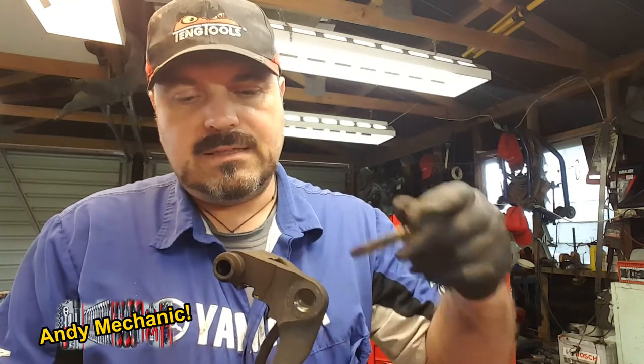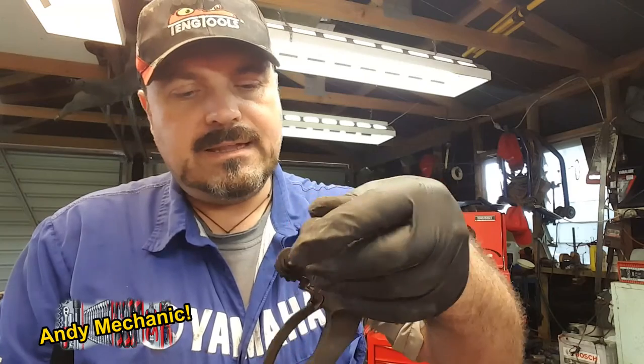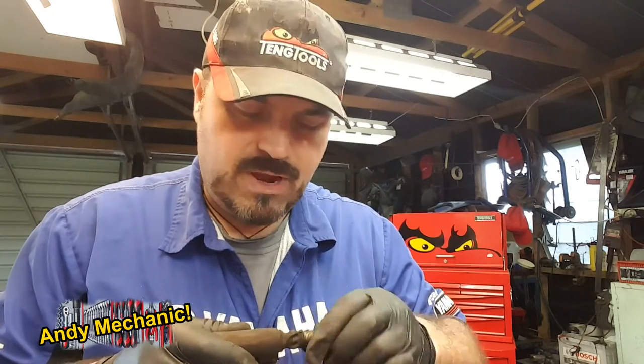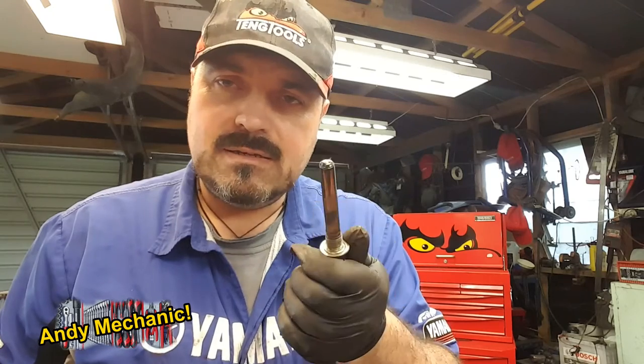Okay, what else have we got to do? Well, we need to check the sliders. We've already taken the pad carrier off, that's here, and it goes on the vehicle. Oh golly, more clips like that. So that's the top one, so that gets the large slider bolt. That goes in there. Now, does that feel nice and smooth? Yeah, it's great actually.